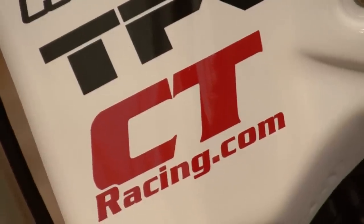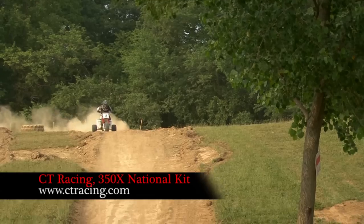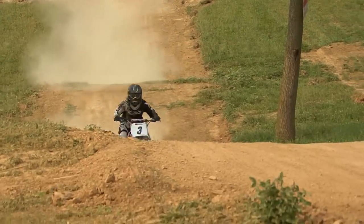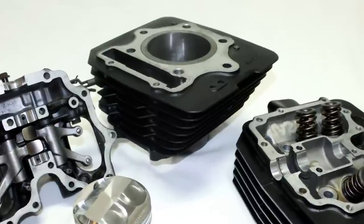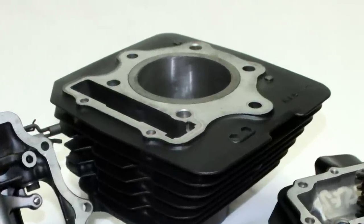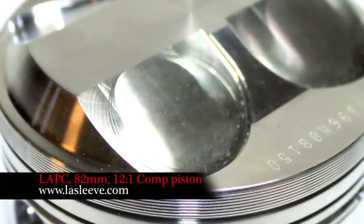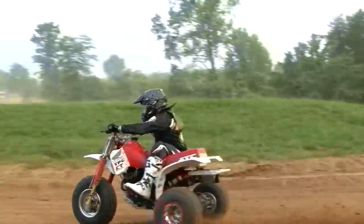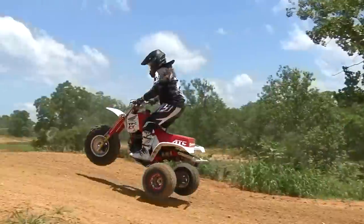CT's 350X National Motor Package is designed to build upon the stock engine's fun and easy-to-ride low-end and mid-range power, providing more horsepower and torque across a broader RPM range. Installing a monster big bore kit may increase horsepower, but it does so while sacrificing some snap and willingness to rev. CT bored our cylinder and replaced the stock 81mm 8.5:1 compression piston with an 82mm 12:1 compression piston with custom ground valve pockets from the Los Angeles Piston Company. Keeping the bore size down keeps piston weight down, allowing for faster revving, while the increase in compression increases horsepower across the RPM range.